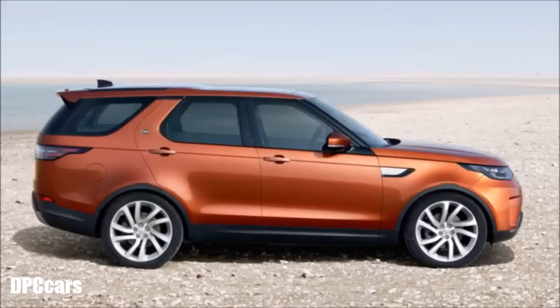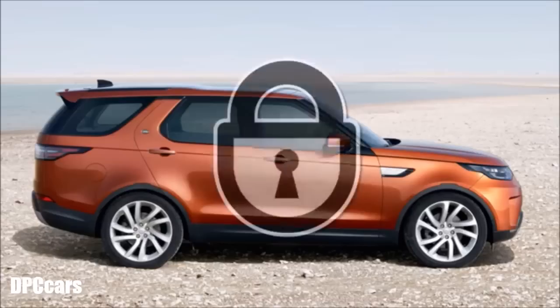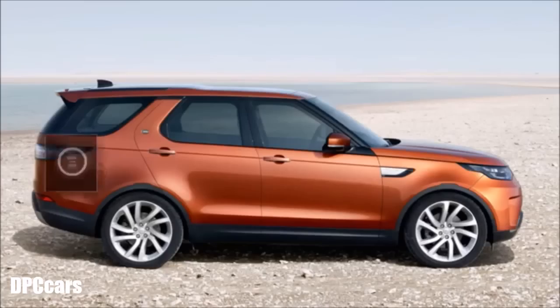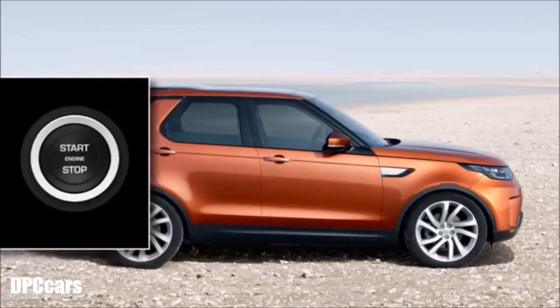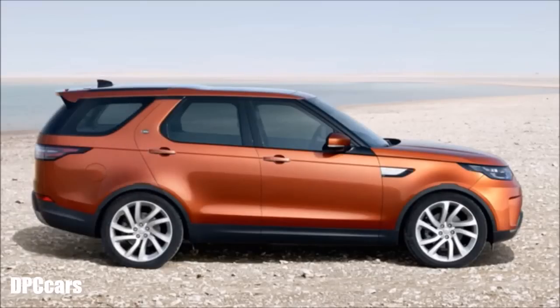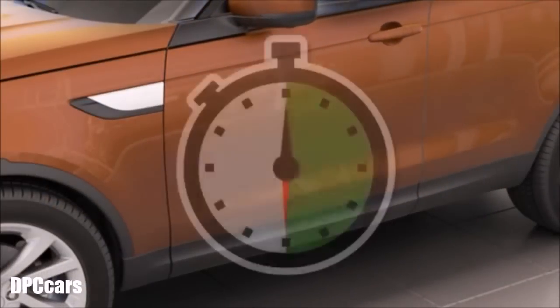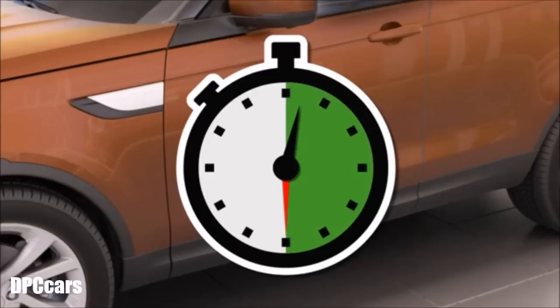When the activity key is activated, the vehicle locks, the alarm system arms, and any valid smart key remaining inside the vehicle disables. To lock your vehicle, the ignition must be switched off, and your smart key remains inside your vehicle. After exiting the vehicle and closing the last open door, the activity key activates for 30 seconds.